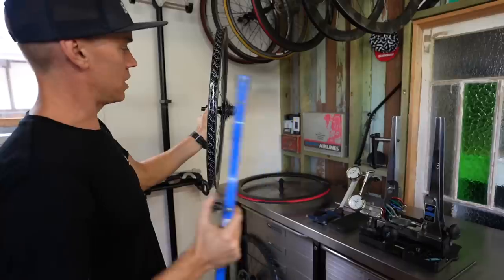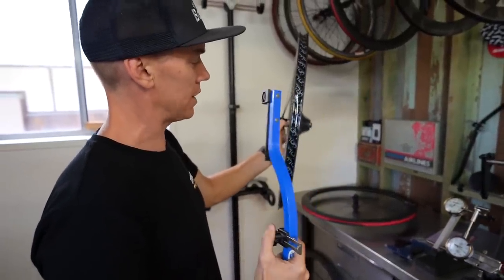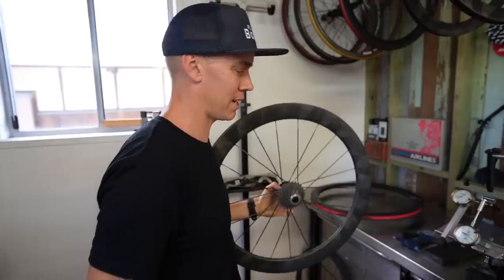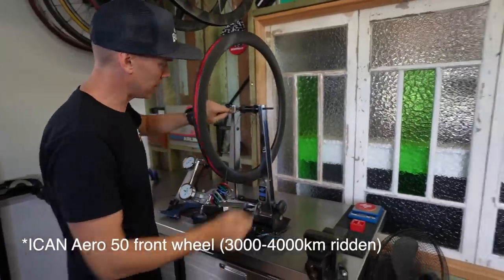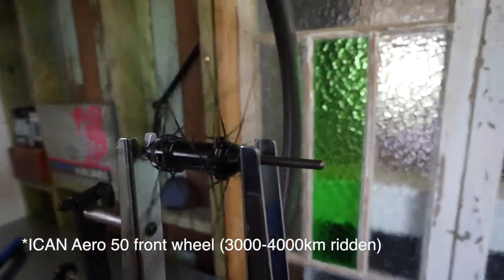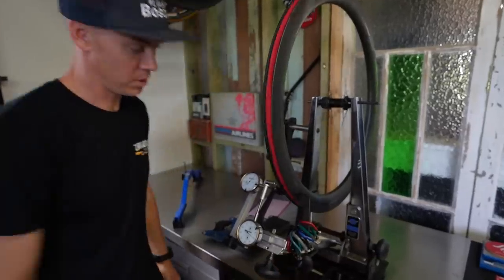It says to add a little bit — sitting drive side to the right, needs to come back to the left. We're talking less than a millimetre. Nominal, don't worry about it. There's a problem though: even when the wheel's just hovering, look at that — the whole axle's turning. The bearings aren't even spinning. It's rumbling a lot.